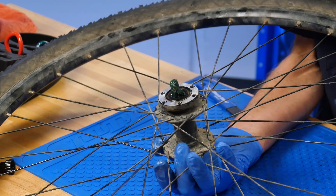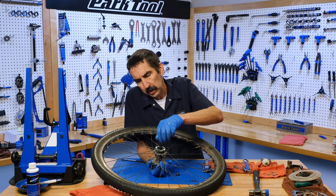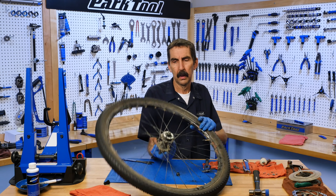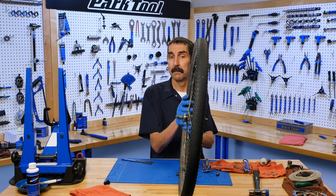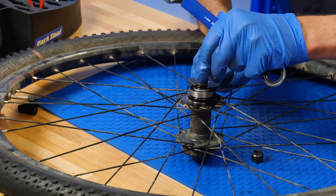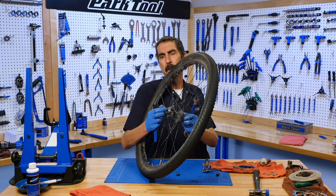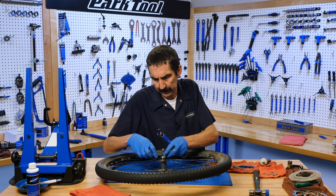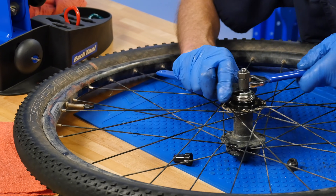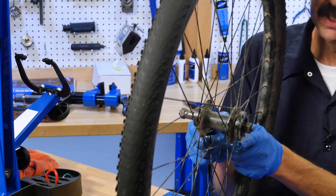Grease over here, and that is for the other cone — it's just going to push it back down. Let's see what the axle protrusion looks like and see if I'm horribly off. Problem — a lot on one side and a little on the other. I'm going to back this out a little bit. There we go. Now I'm going to tighten it down again. Come at it from the other side. Good and tight. Not bad — a little protrusion, a little protrusion. It's going to sit in the frame. Beautiful.